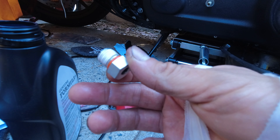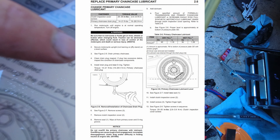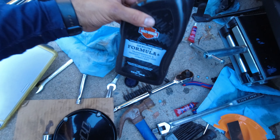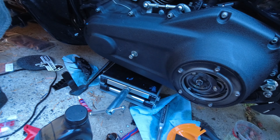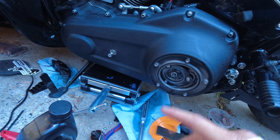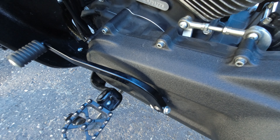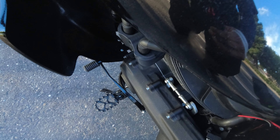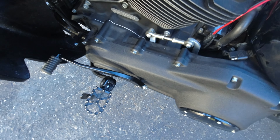For the drain plug I used Teflon tape and a new O-ring. Unfortunately I forgot to install the plug before filling, so I lost my precisely measured primary fluid and had to go by eye using Harley's published fluid specs from the manual. That's pretty much it — thanks for watching. If you want to keep it stock go with the ramp; if you want more responsiveness and torque and don't mind the potential noise, the Man of War comp is probably your option. Get out there and ride.